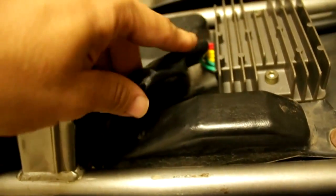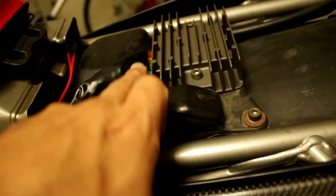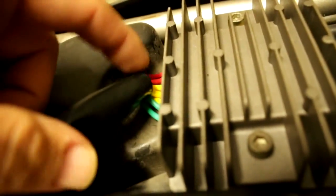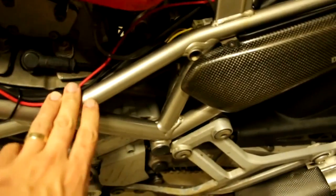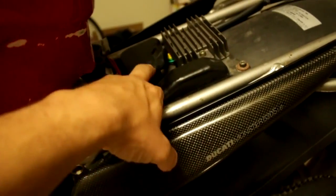Taking the rear seat off, you can see this wonderful little contraption here — this is the rectifier regulator. They all pretty much have fins so they can dissipate heat. Now this wiring here — this is where you can see I've had to start doing some work. What I ended up doing was splicing off the two red cables. There are two red cables and two green cables coming out, and I had to cut the two red cables and run new wire from there straight to the battery.